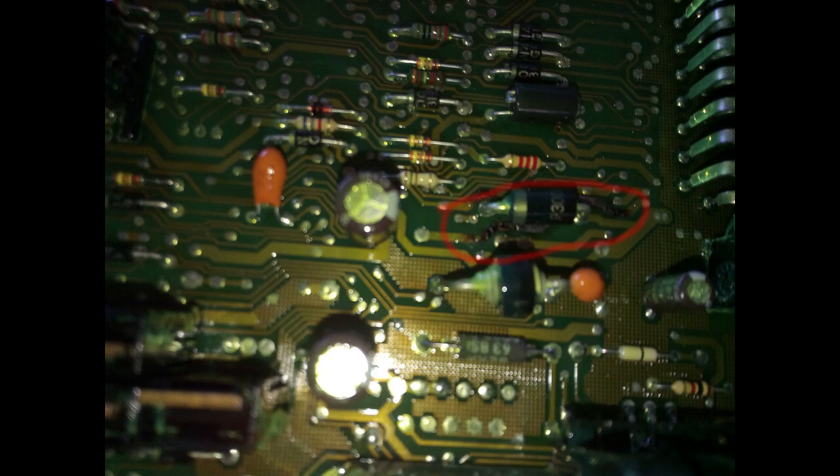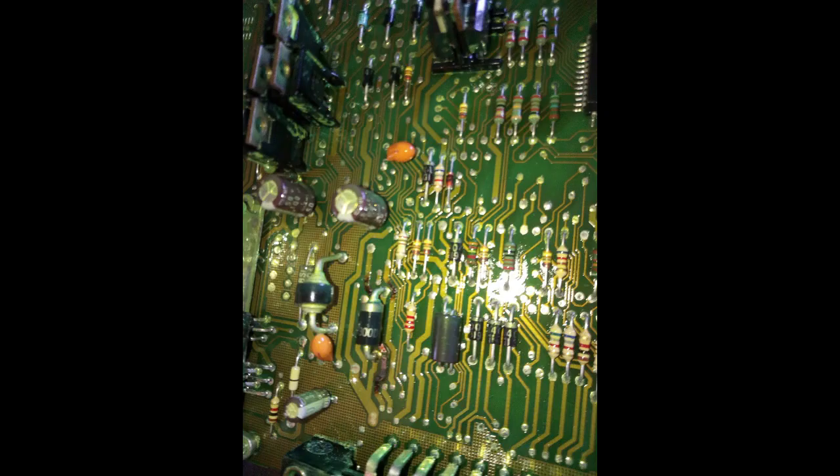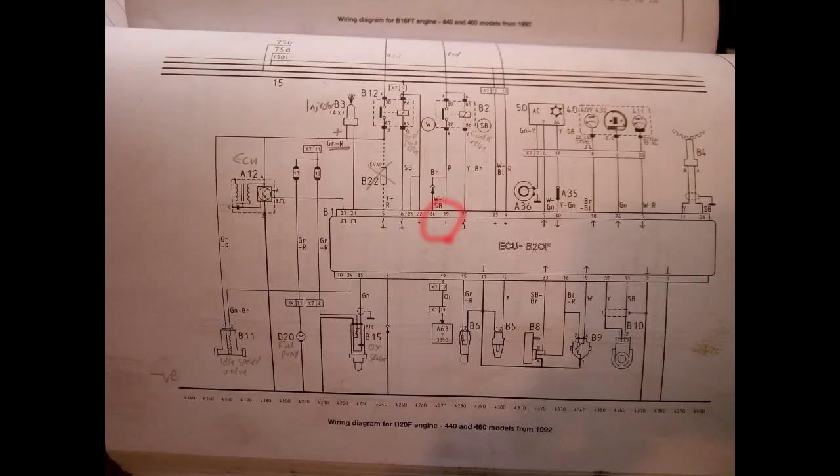I'm not sure whether we're going to be able to salvage this ECU. My gut instinct is that we're not, because even by jumpering across those wires — we could solder a wire across — I think the rest of the CPU will have been irreversibly damaged. If we take a look at the wiring diagram which we've got for the ECU, this is the B20F ECU, and look at the bit that I've highlighted — pin 19 and 20. Pin 19 is the one that had the damaged trace, the burnt trace. Following that through, that is the ignition signal from the car — it gets positive 12 volts when the ignition is on. So it would explain the ECU having so many problems, because it is the primary signal wire. That's where we're having our problems.